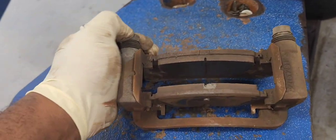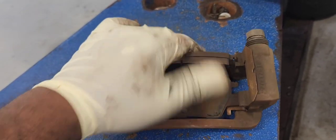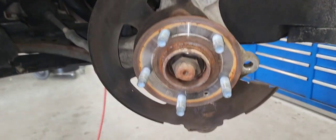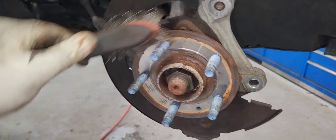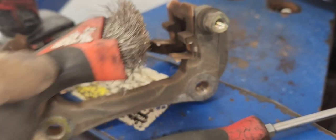In the case of that one, those brake pads were seized. So we're going to need some real effort to remove them and we have to re-grease the pins. We're going to clean the brake hub using a wire brush like this and clean our brake caliper bracket.